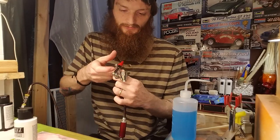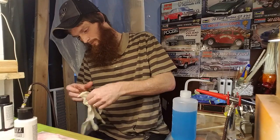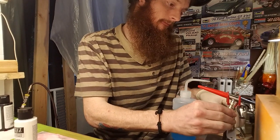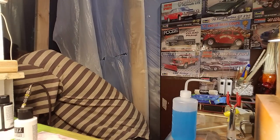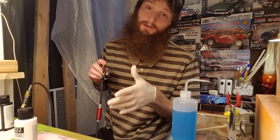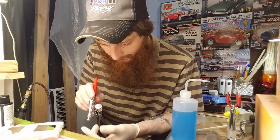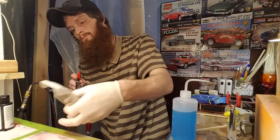Okay, so color cup's loaded. Set it down for a second here. Get a glove on. All right, guys. So let me crank my compressor up. Sure she's at a high enough PSI. Okay, so I'm gonna try it out first at 20 PSI. And I'm just gonna hold the body and spray it and see how it goes. Alright, so here we go.